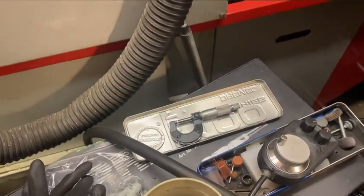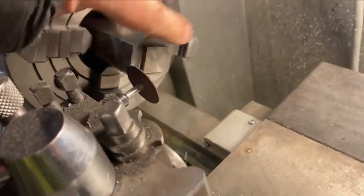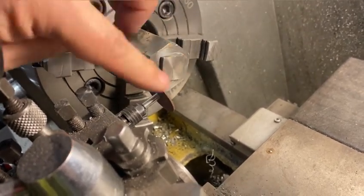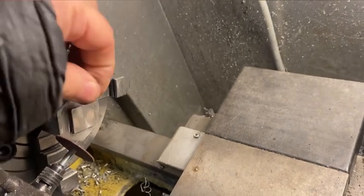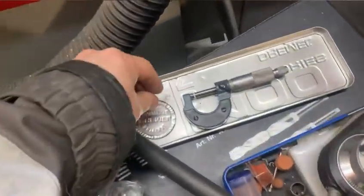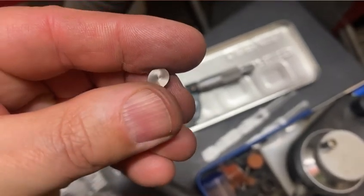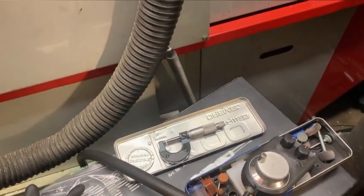Now we can take the engine, assemble the camshafts and so on. If you have any questions put them down below, and feel free to subscribe. The setup uses a stack of four neodymium magnets super glued onto bar stock ground with a cutting disc. Use a washer because it gives much more surface area for the magnet and you don't risk the little shim flying off. There's the valve side and the ground side that goes to the lifter.